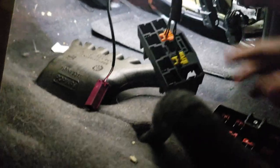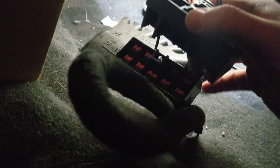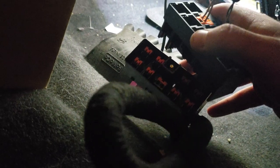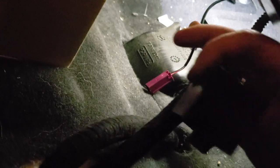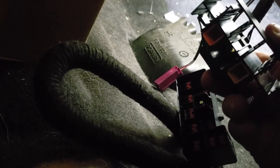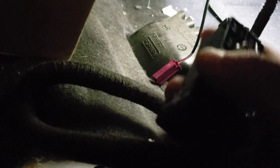The other thing you have to do when replacing the seat belt buckle is take this off — it's one component. It slides off this little metal piece right here. There's a little tab right here; you push it down and it slides off. Then you separate these two pieces. The tab is on this side, goes between here and sits on this piece right here.